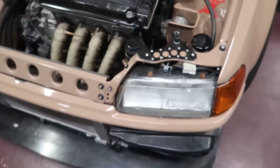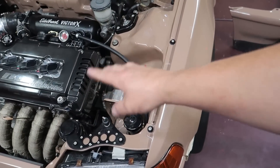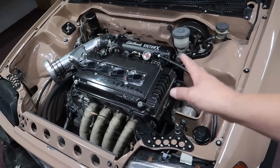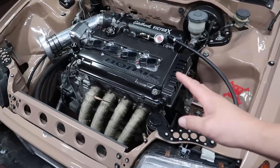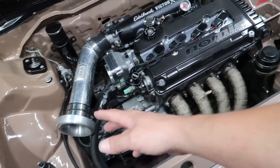For the time being, I'm wanting to satisfy not only my curiosity but a lot of your guys's curiosity as to whether or not Khaki's timing is off. So we need to check the timing marks - we're going to spin the engine, line it up, make sure all the timing marks are lined up. I've already done this but I didn't do it on camera. I also want to go through the valves and check the valve lash.